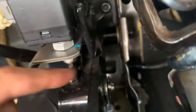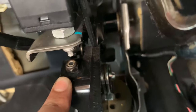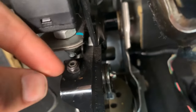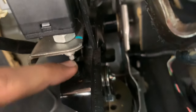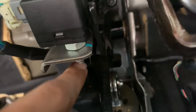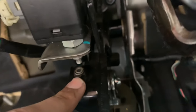It was just this piece — the little aglet-type thing. It's a little plastic pop-in piece, like a little tube that goes inside of this hole. That tube piece broke off and the circle piece surrounding it snapped in half and fell out. So basically there's a hole here, and the switch plunger goes straight into the hole and doesn't get depressed like it's supposed to when the brake pedal comes back up after being pressed.